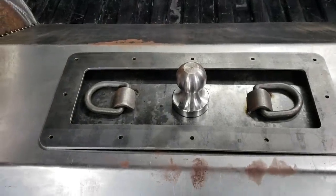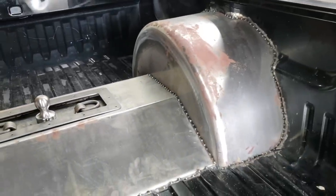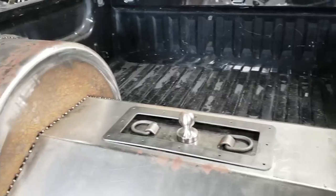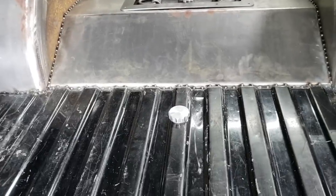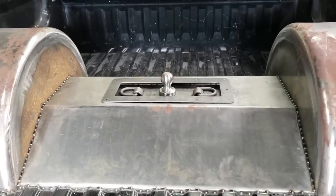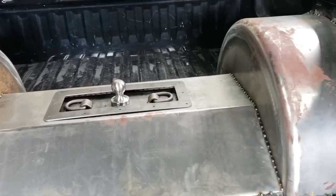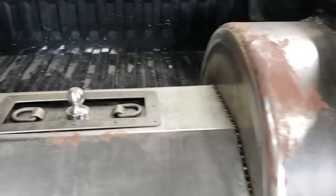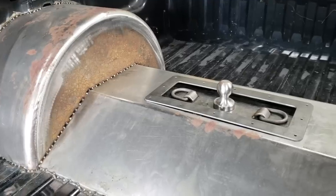We also added a cool feature — it's not going to be towing, but being that it's a small baby dually, that's going to look really neat. A couple of things have changed: we're actually going to be doing air suspension, not the coilovers I mentioned earlier. He also needs a fuel cell because the wishbone suspension would hit the factory gas tank. With the fuel cell we can run a four-link suspension instead.